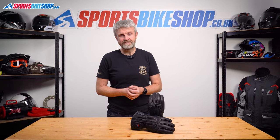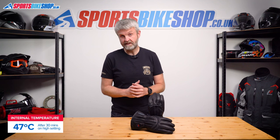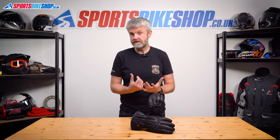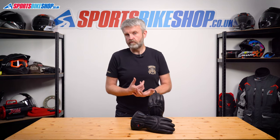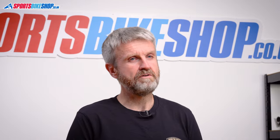When we tested both pairs — the old and these new ones — it was clear the new ones were significantly warmer. After half an hour connected to a 12 volt bike battery on the highest level, the new gloves showed an internal temperature of 47 degrees C, which is 10 degrees more than those old gloves. These come with the kit to connect to the bike battery, but you can also power them from Gerbing wrist batteries. However, the warmest internal temperature we saw when connected to the 7.4 volt batteries was only 34 degrees.